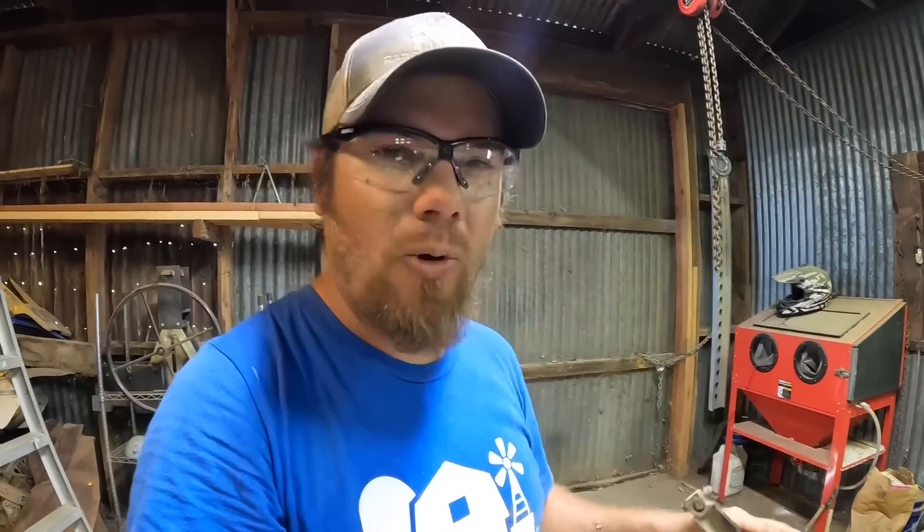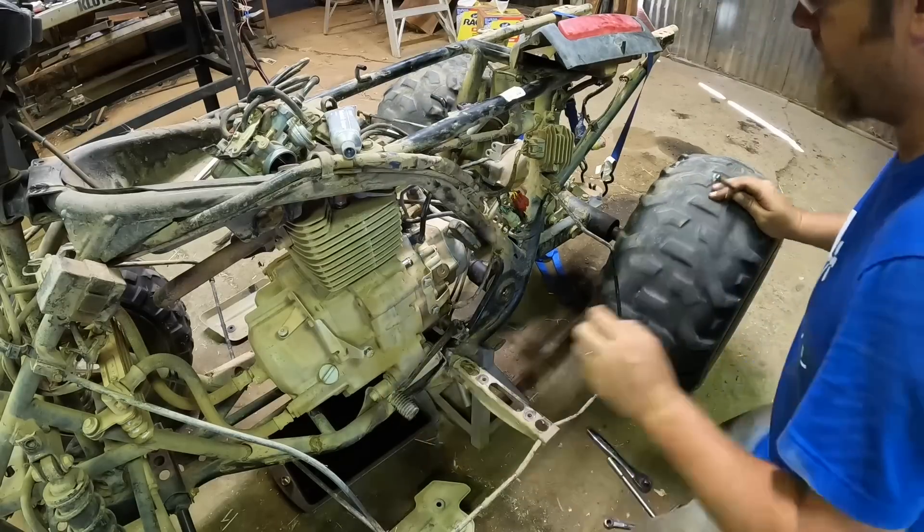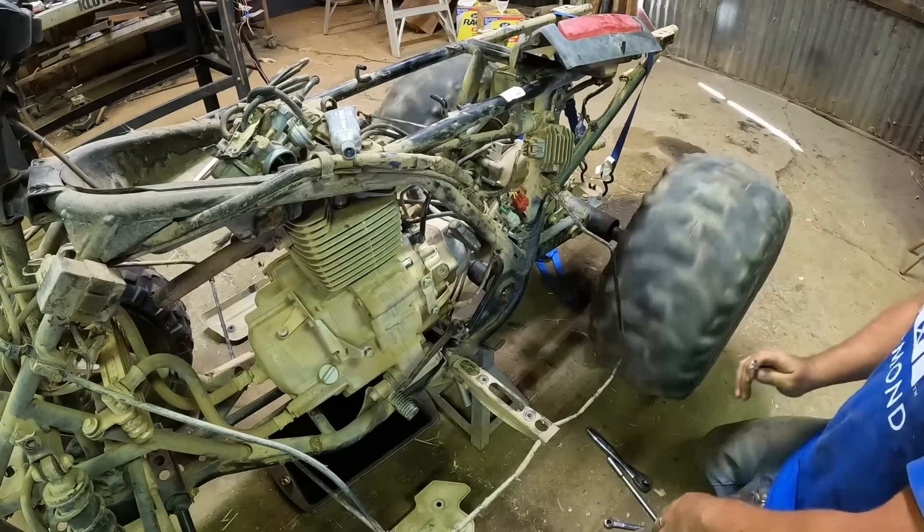The last check now that this is all hooked up: I want to hook the shifter back up and put the quad into first gear just to verify it's actually going into first gear. When I had to take the rear case off I had to disconnect all that shift linkage, and when you put the case back together you're going by feel to ensure those parts are aligned. So the only way to know is to put it in first gear and see if you can spin the tires or feel resistance. We're in neutral now — put it in first — can't spin it — back to neutral — okay, that verifies everything went back together the way it's supposed to.